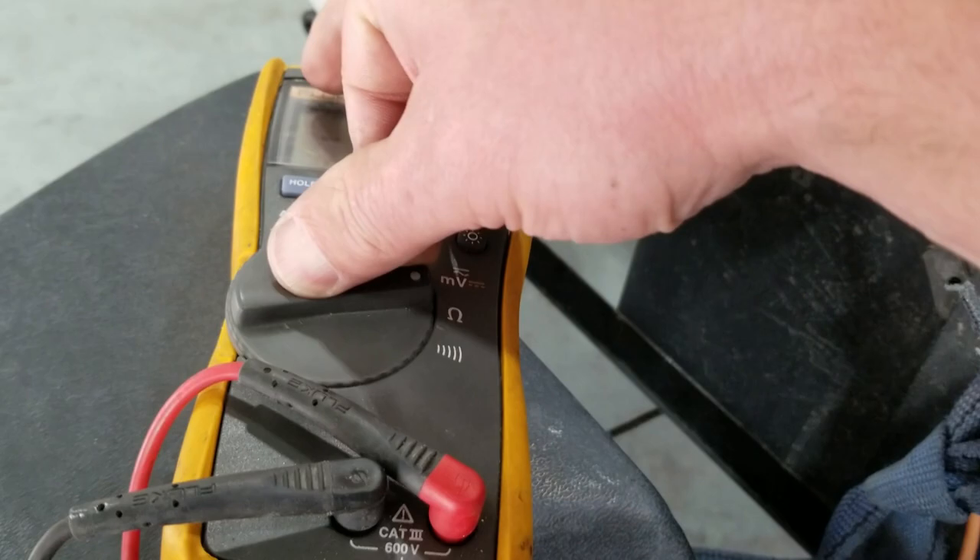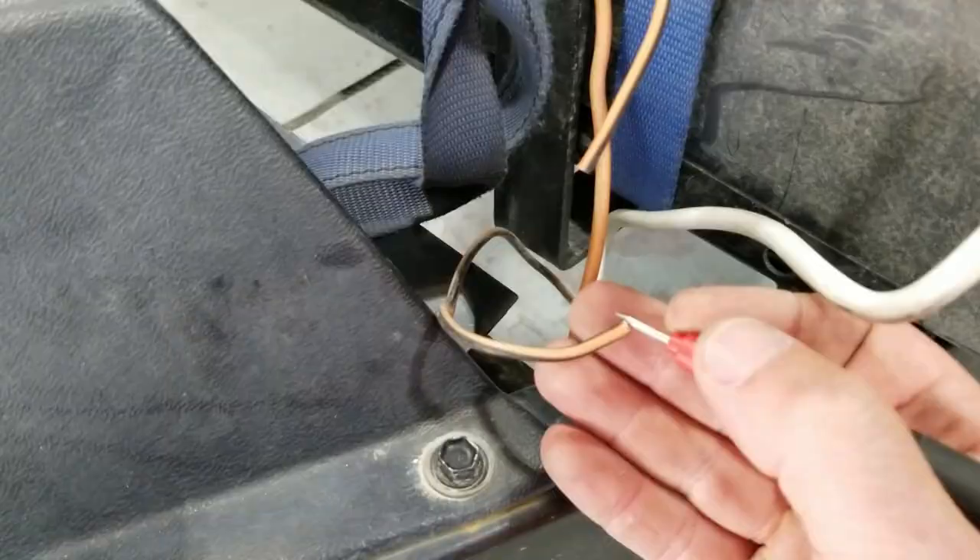One lead on the ground, meter on the ohms, and put our probe end on that wire. There's your trouble. 1.2 ohms would be 10 amps — 10 amps for this little tiny trailer. Far too many amps.